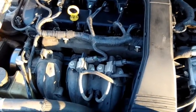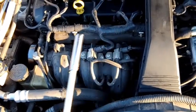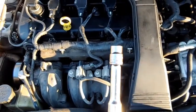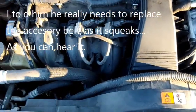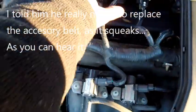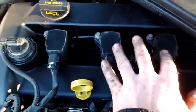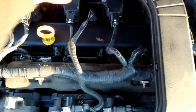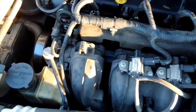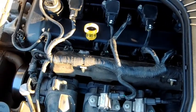A very straightforward job. All you'll need is an 8mm and a 10mm, quarter-inch and three-eighths drive — that's all you need. An 8 and a 10 and you can pretty much do this whole job in an afternoon — twenty to thirty minutes is all you'll need. I spent most of the time cleaning out this valley and getting the oil out of those two middle sections. Other than that, just tighten all your bolts, take the valve cover off, clean up the metal where it meets the head, put the new gaskets in, and hopefully no more leaks — not bad for 176,000 miles. Thanks for watching, hope this helped somebody.